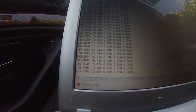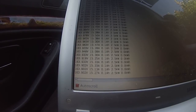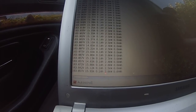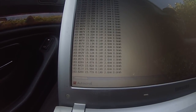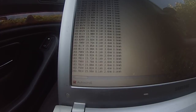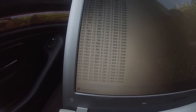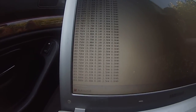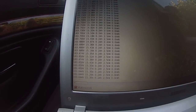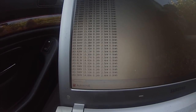Now what I'm finding, this either thinks I'm charging the battery now, which I'm not, or it's going to clock from the bottom of the pack, or from the top of the pack, and show me how many amp hours I have that way. I'm not 100% sure, as I did double check that I had the shunt wired in the right direction, and I did, so that could be something that we need to address, as this awfully looks like it's actually charging the pack.